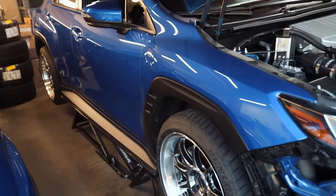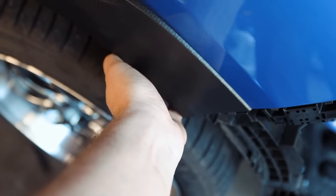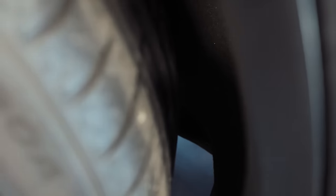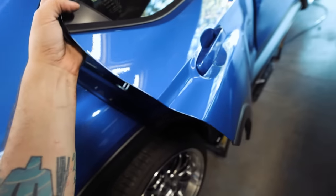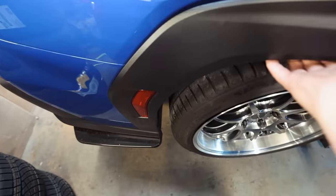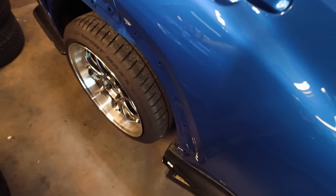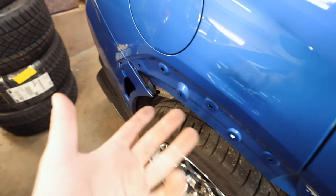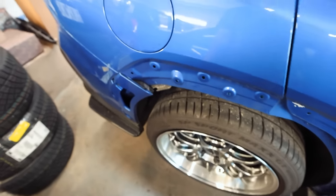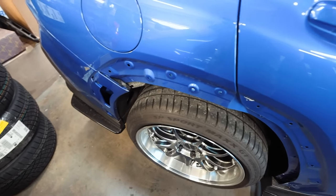I don't know how to get the rest of these off, but we're gonna find out. I see a pop clip right here but I don't know if that's actually for the flare. I feel like I can just yeet this off, but I probably should watch a video before pulling things off. For the rears, there's a pop clip right there that holds the flare in. They literally just pull off — there are two clips up in here for this rear bumper and then it just pulls off. They put the screw to take the rear bumper off behind the flare. So we're just going to transfer the clips from the stock one over to the new flares. There's a bit of 3M tape so we put some on the new one and they literally just clip right on.